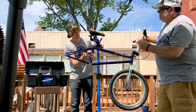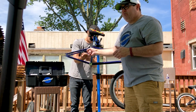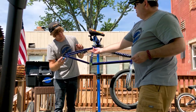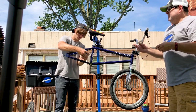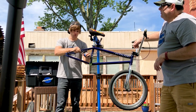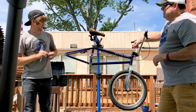What he means by some bikes having springs: when you squeeze your brakes, they hit the wheel, and when you let out your lever, they pop back out. This brake has a spring between the arms that pulls the arms back at the top, which spreads out the brake pads. A lot of brakes will have a spring inside the brake arm itself, and you have to tension that spring and tighten your brake down — it can be a little complicated. The springs are also directional, so they only work on one side. If you take out your springs and lose track of which one goes where, you have to figure it out — and if you do it backwards, your brakes won't work at all.